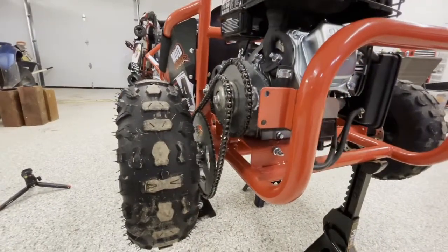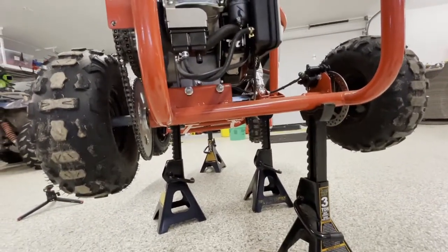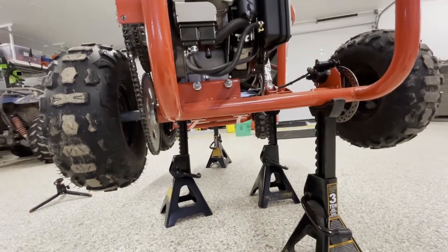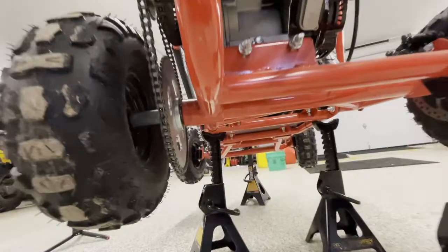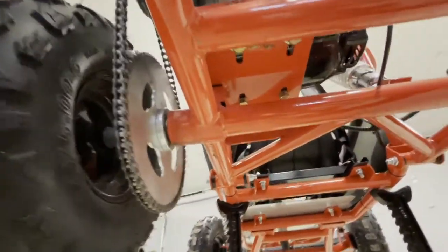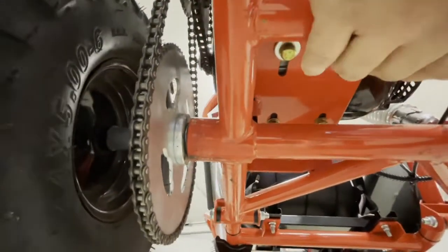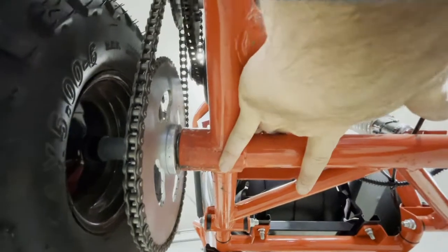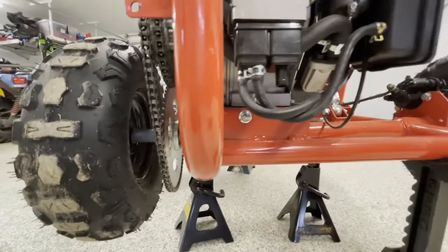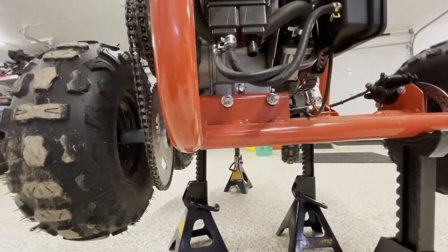The engine pulling backwards is going to tighten that chain up. If you need to loosen the chain, we're going to have to push the engine forward a little bit manually, because there's no force from those bolts. The second set is the bolts holding the motor to the frame — there are four bolts underneath, and those are 13mm bolts. The ones on the back are 12mm. The ones we took off the chain guard are 10mm.